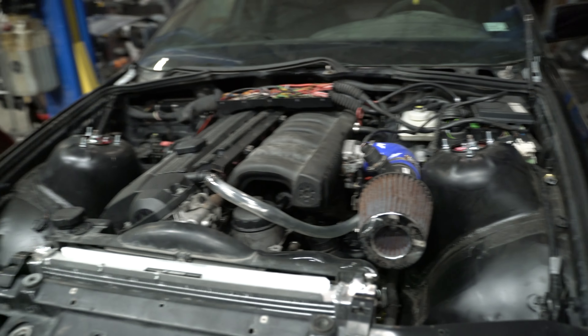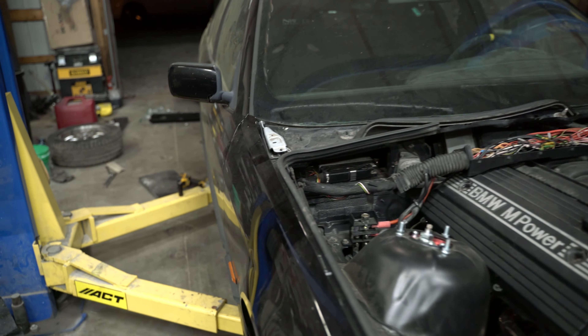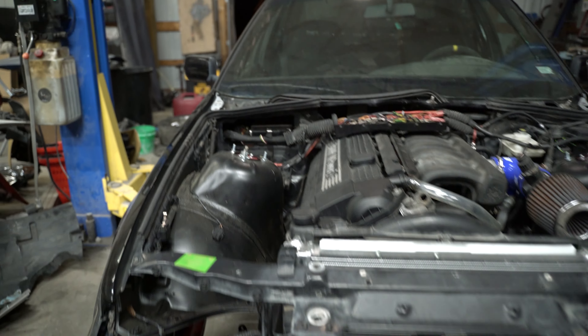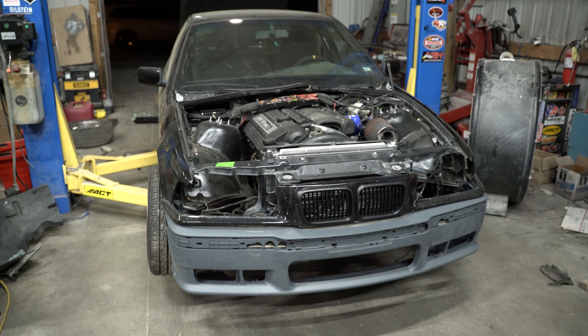Engine's in and I've already started it — everything runs, everything sounds good. I didn't record it because I was frustrated about the ECU. It came out of my parts E36 and I thought it was a red-label 413, but instead it's the silver one with the EWS system. I plugged everything in and it didn't want to crank at all. I found where the EWS module is — there are two thick power wires, green, black, yellow. I just threw a jumper in it and that bypasses the EWS system. It literally fired on the first crank. Let me start it up so you guys can hear how it sounds.